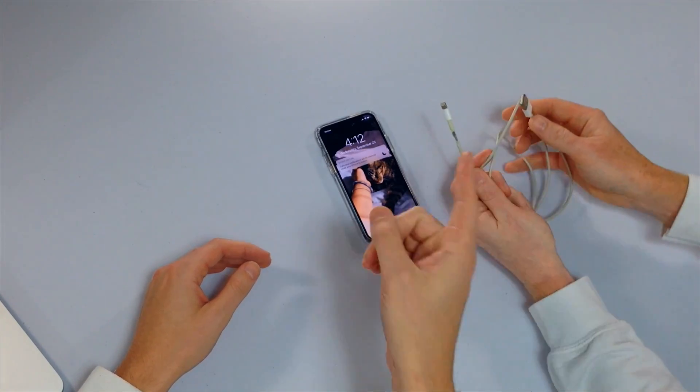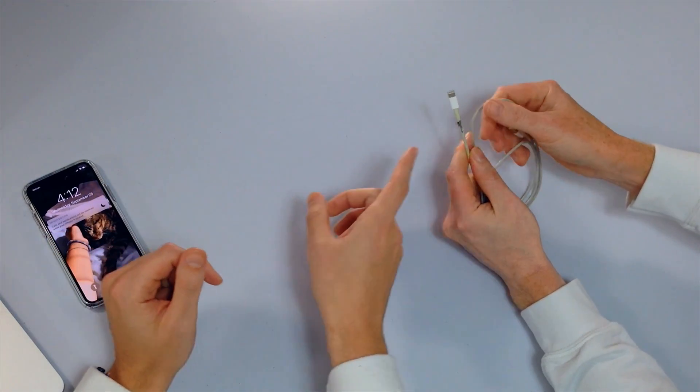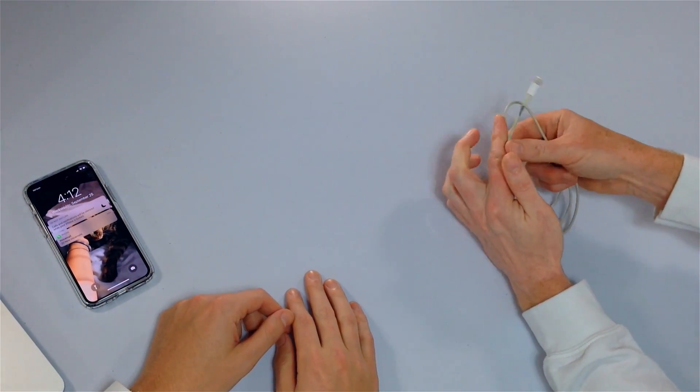If that didn't work, it might be an issue where your iPhone 11 isn't charging. First thing to check: is your charging cable in good shape? This is an example of a charging cable that's not in good shape — it's frayed. Try a different charging cable. Same thing — try a different charger. Maybe your charger is busted, or maybe there's a problem with your USB port. Try a wall charger; if you're using a wall charger, try a USB port. And people ask: is it okay to use the old charger and old cable? Yes, it's okay to use the old cables.